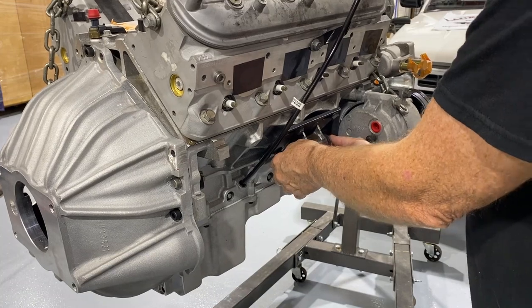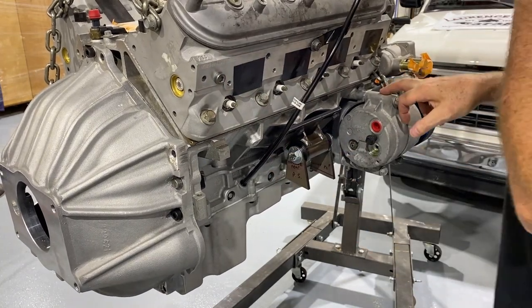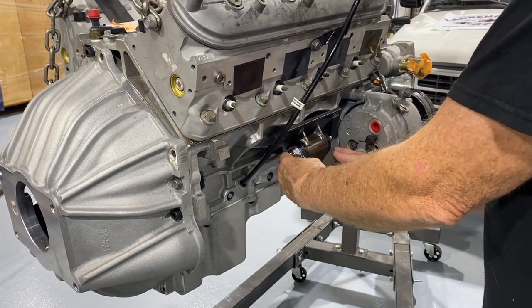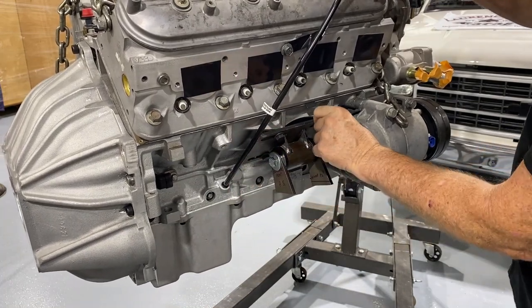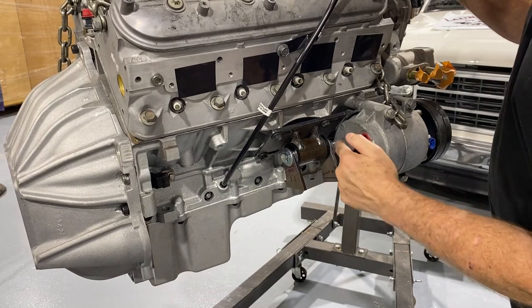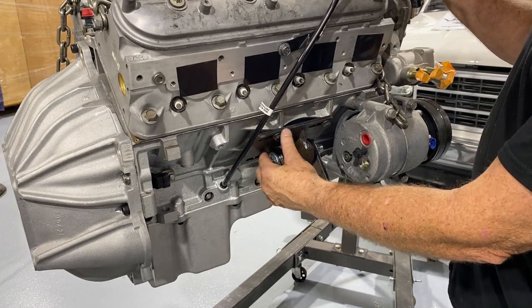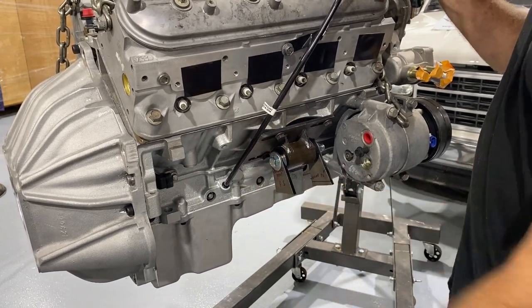I have to put the motor mount bolts in from the back side forward because, on this side especially, where the air conditioning compressor is, if you put the bolt in from the front you couldn't — the length needed means the compressor is in the way. It has to go in from the back side. I'll snug it up so I can still move it once it gets in. Right now the plate is positioned in its rearward-most position. When it goes forward, the motor mount bolt almost touches — when snugged up it might actually touch the compressor. We're going to start in this position and slowly push the engine back. The only way we can tell is to drop this thing in there and find out.